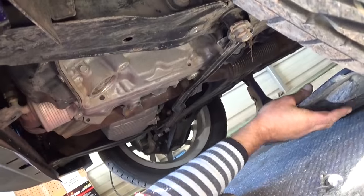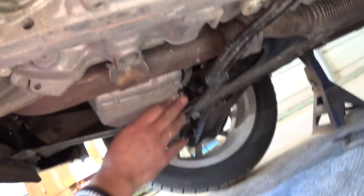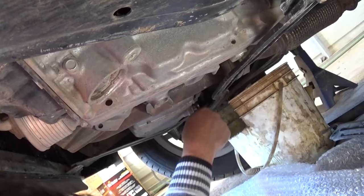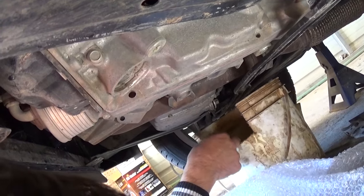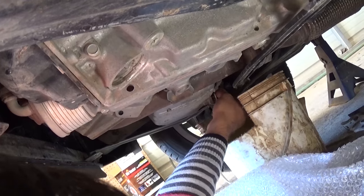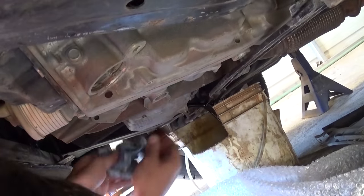As you can see, the oil plug is located right there. Now with a 13-millimeter wrench, take off the oil plug all the way. Make sure you have something to catch the oil with because it's always going to make a mess. It doesn't hold much oil so it won't be too much — about a gallon — just let it drain good.